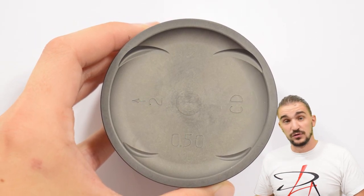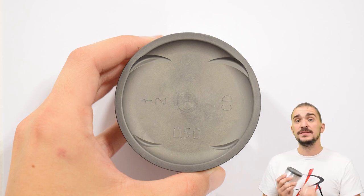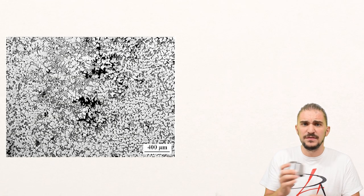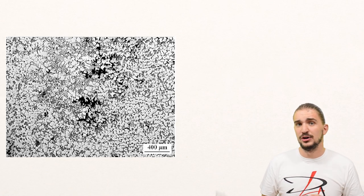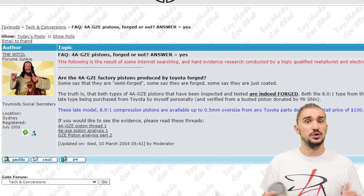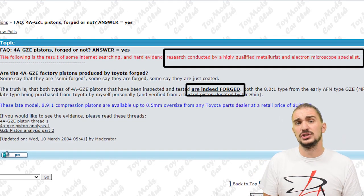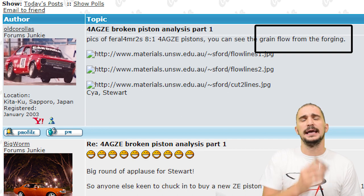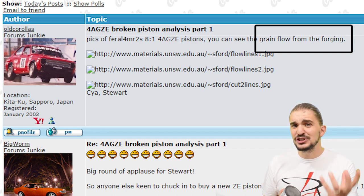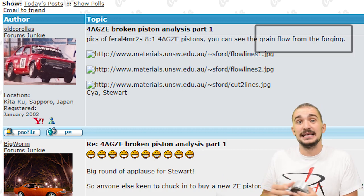This smooth surface finish is great for applying all sorts of coatings onto the piston — as you can see, this one has a thermal coating on top. Another benefit is excellent grain flow: semi-solid cast parts have a very fine, uniform, and coherent microstructure. This is why these pistons confused people on the Toy Mods forums — a forum member actually took these pistons under an electron microscope to answer whether they are forged or cast. Although the images are no longer available, the conclusion was that they are definitely forged. And although they're not, this confirmed that semi-solid cast parts actually have a grain flow identical to that of forged pistons.